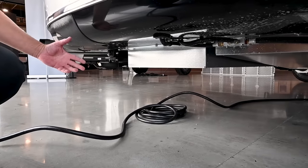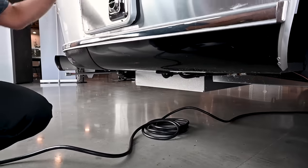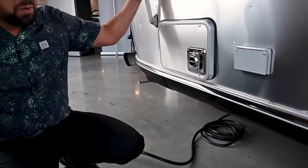There are stabilizer jacks at all four corners. They're not meant to level the trailer — you crank them down with the included tool to stabilize the trailer so it doesn't bounce when you walk around inside. There's also a spare tire we'll see up front. There are jack locations underneath each Airstream travel trailer marked with a sticker and metal plate; use the bottle jack from your tow vehicle to lift a portion of the trailer.